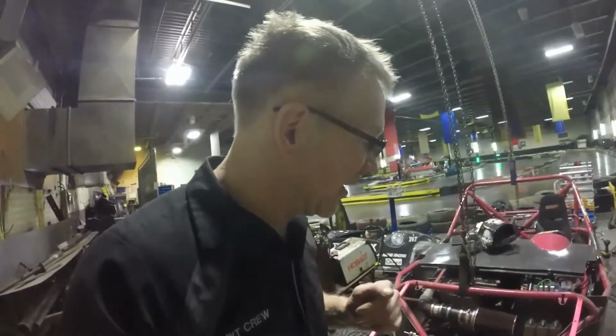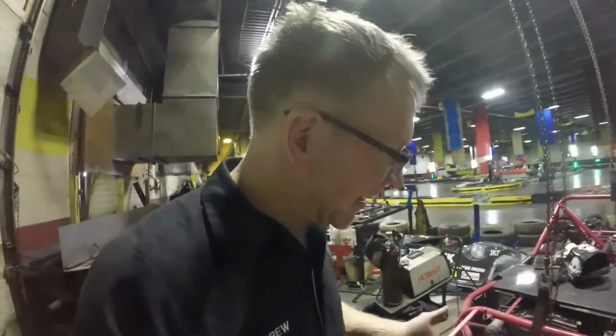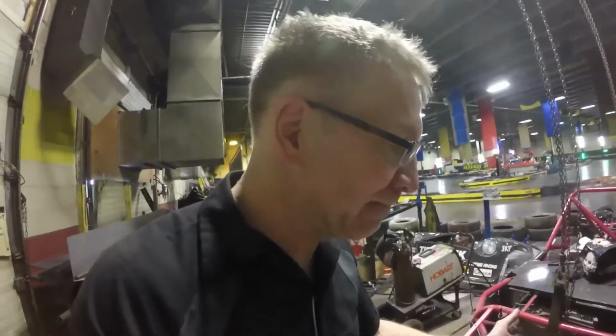So I will be cutting and taping and drilling cardboard into the shape of the structure that I need to hold my shocks in place. And the angle of the shocks affects how much effectiveness the springs have. So I'm going to put a couple of different adjustments in there in case I want to slightly stiffen or slightly soften the spring rate of the springs. So, all right, that's what I'm going to do. Follow along.